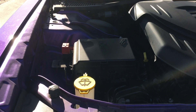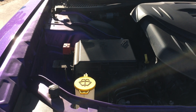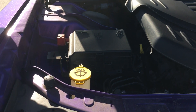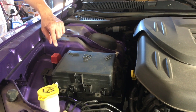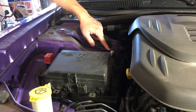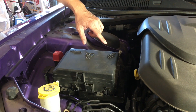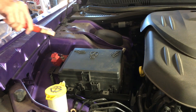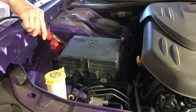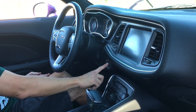As you will see, the battery is not here — it's in the back, but let's talk about that later. The battery terminals are up front: the red for the positive and the negative ground right here. You can see from the diagram on the black box the direction where you should connect the jumper cable. Connect the positive here on the red, and then the negative on the black back here, which is your ground. Then start your car.